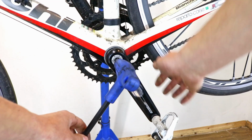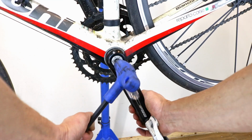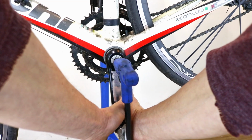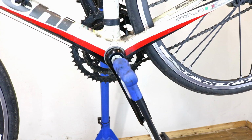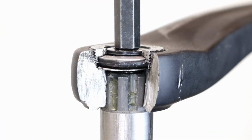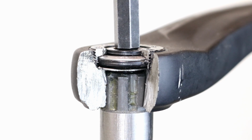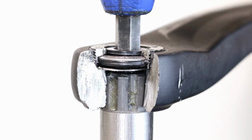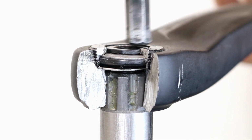Now, holding the tool and crank with open hands, push them together until you feel the bolt release. This bolt will probably be really tight, so expect to use a lot of force. Undo a little bit more until the bolt feels tight again. This is because it is butting up against the retaining ring. Now repeat the process of undoing the bolt until it feels loose.